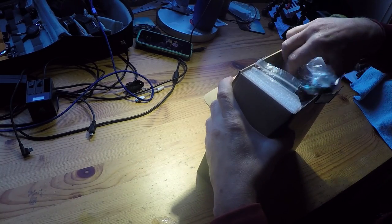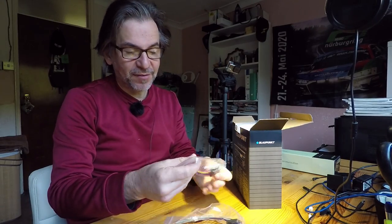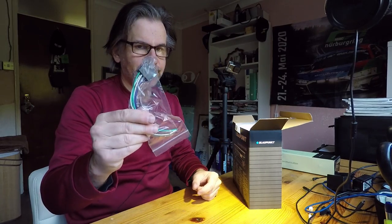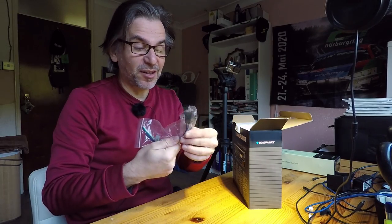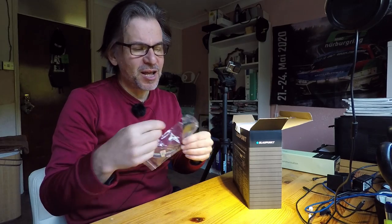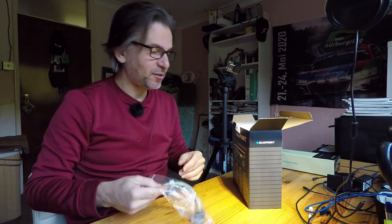At the top of the box we've got some ISO leads, basically designed to connect to the ones in your car if you haven't got these already. That's the power version, and the 4x2 is for the speakers. The good news is my car already has these fitted to work with the JVC, as it's a standard size plug. You might need to check which is the permanent live and which is the ignition live, as that can vary — if you turn the stereo off and it forgets all settings, it hasn't got a permanent live keeping the memory alive.